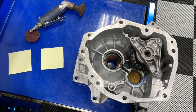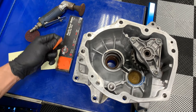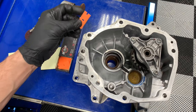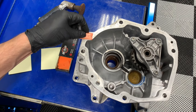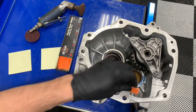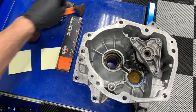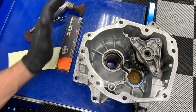What we use to clean this stuff is plastic razor blades — yes, they make them in all different edge sharpnesses. We scrape until everything comes up as much as possible for a nice clean surface. If it's not catching with a nail and you can't feel it with your finger, then it's not causing an issue.